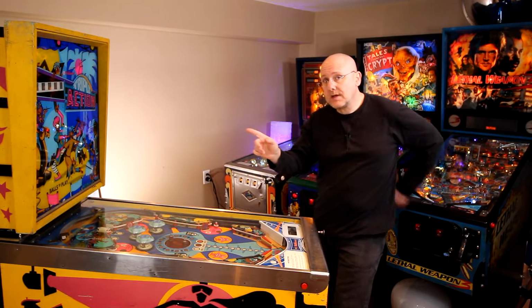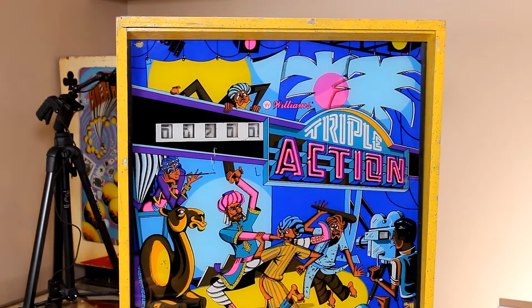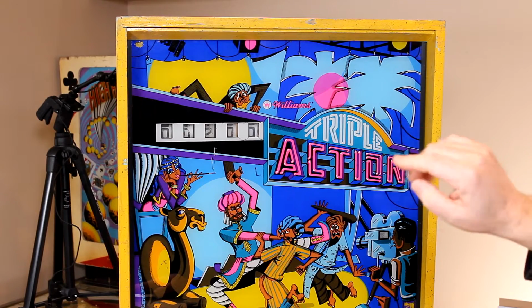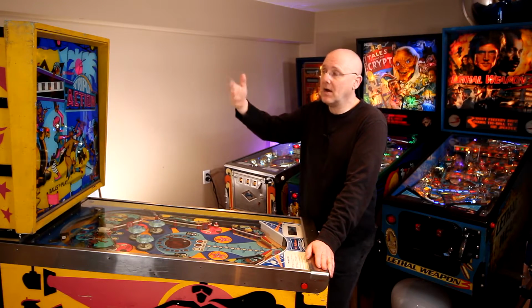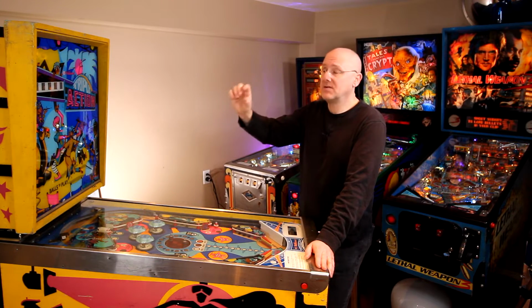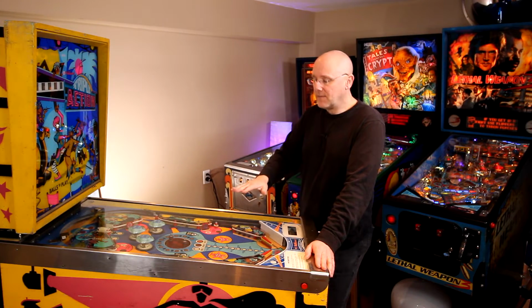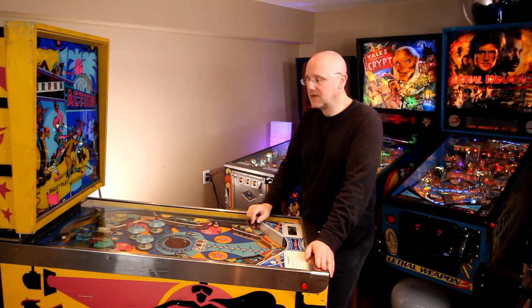Now on player scores, it's really easy because you can tell if they reset or not. If it's sitting there spinning and all of your scores are at 0, one of them may not be connected and it may not get the signal to reset. One of them may be a little bit out of whack, and so it's not closing the switch that it needs to close.